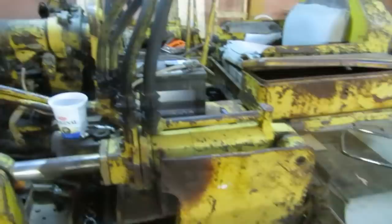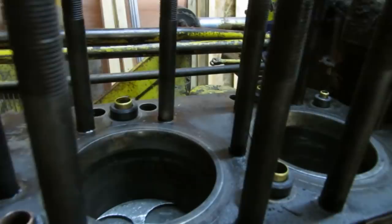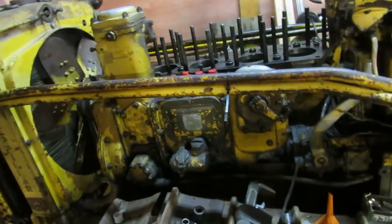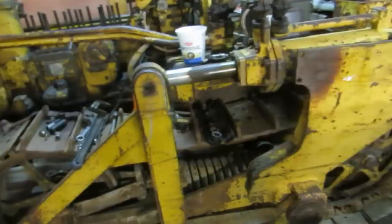I actually went today to Caterpillar themselves to get these little rubbers here. It's pretty ingenious. All the water passages are just sealed with these little things with the rubber washers. The plan now is just to paint that head gasket that came off of it, because it doesn't seem terrible. Then try and run it and see if there are other problems with it, or perhaps if that piston is no good, or if the injection system is. Yeah, if everything works. If it proves itself, then it'll get some more bits. Put a proper head gasket in it. Because it's not too bad to do.